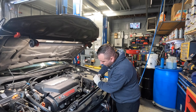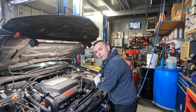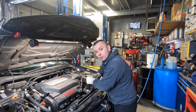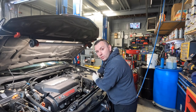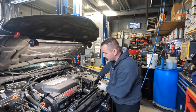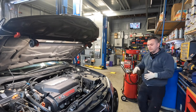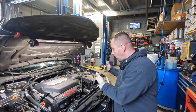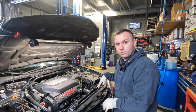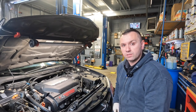I'm using a regular garden hose — not filtered or distilled water here. I'm putting it on the top of the radiator neck and filling up my radiator with water. Keep in mind the lower hose is disconnected from the engine, so the purpose is to flush any contaminants and rust particles downward to get the maximum amount of dirt out. After I give it a couple more minutes and let it all drain out of the radiator, I'll go back underneath, reconnect the lower radiator hose, and then come back when it's time to refill and add the system cleaner.